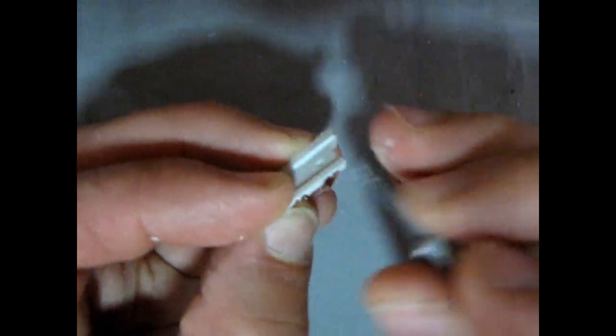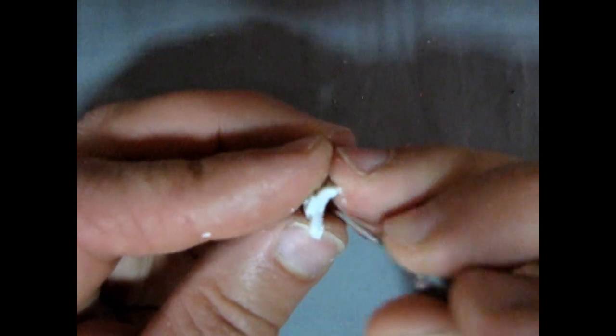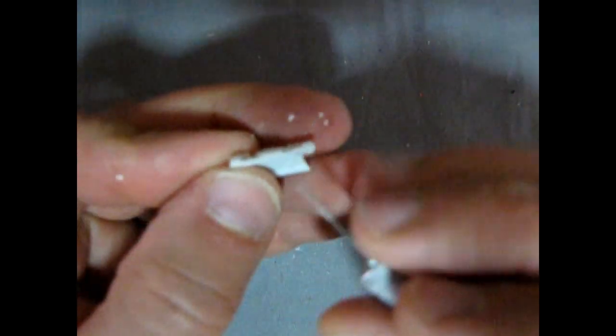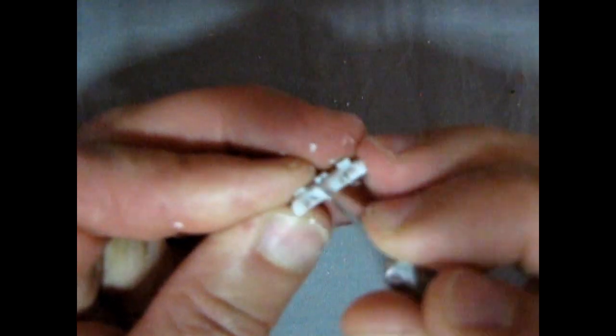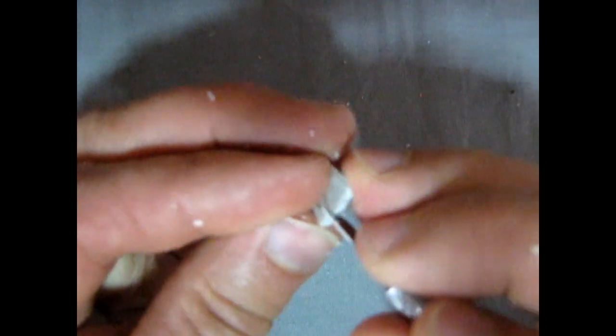I think it said 60. 1960 Buick Nailhead. So I'm just sort of scraping out the flash out of here. Let's go along, sing our song, and there, that's what we want to do. Get rid of all the flash out of here, so that the top of our intake, or the sides of our intake manifold are nice and smooth, without that sharp edge in there.